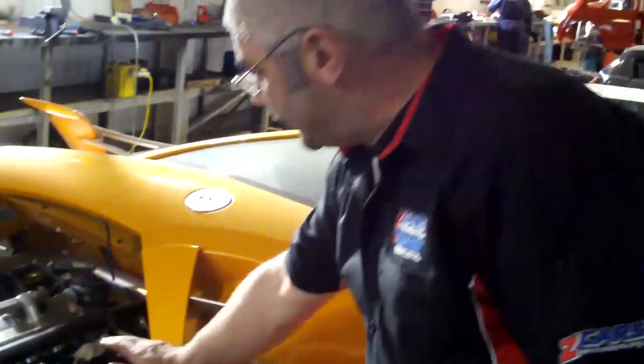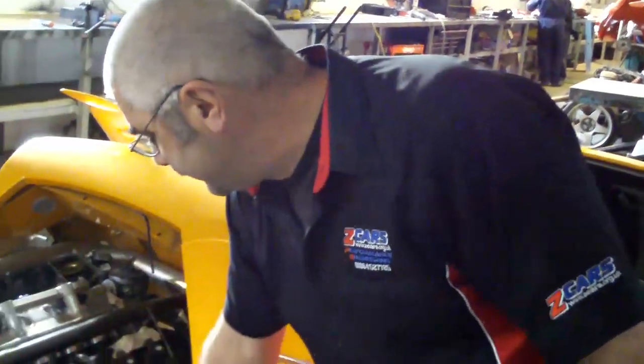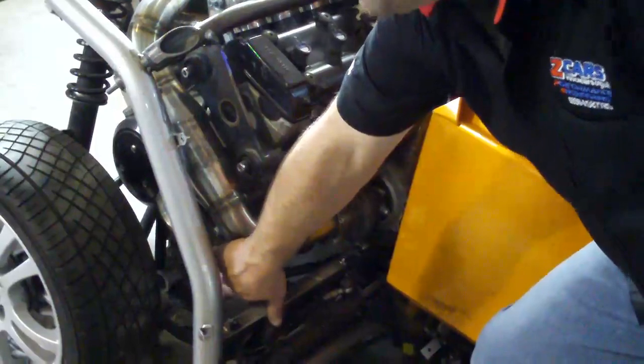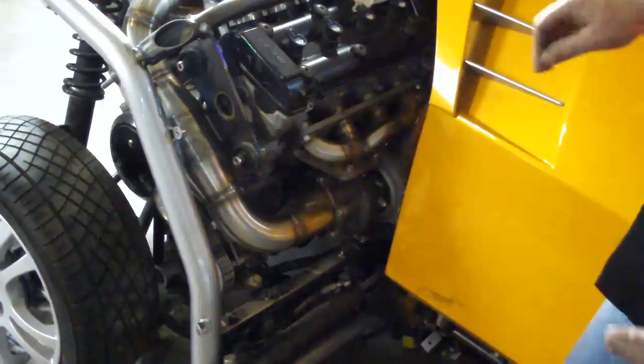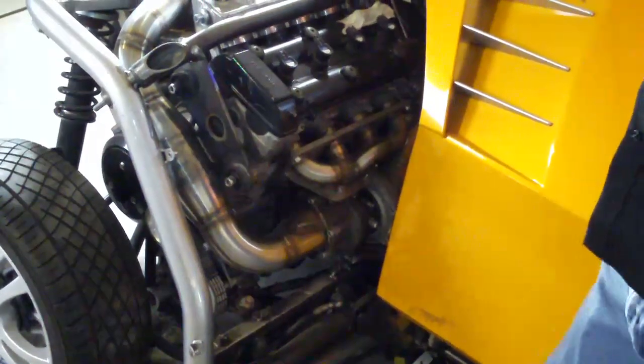I have to say it's the tightest installation we've ever done in anything. One of the problems is that the two strut tops are so close together — the wheel track is extremely narrow. The car itself leans backwards and forwards as it goes around the bends, so the available space around everything is very, very tight. You've got no room at the front. It's got to run an oil pump and a bigger alternator because of all the electronics on it. When it leans in the corners it's actually pushed by a hydraulic ram, all computer controlled. So now it's gone up four times in horsepower, it's quite a complex piece of kit.